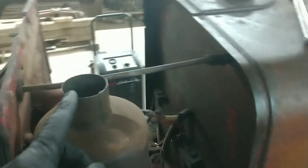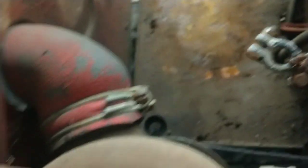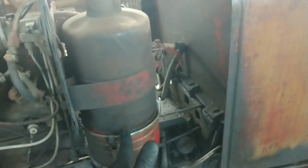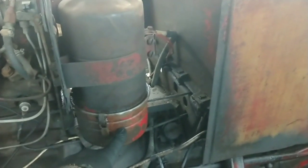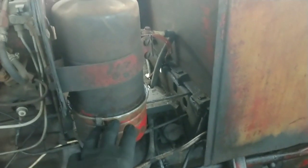So you see up here, air obviously comes in. It goes down a canister, and then the air comes out here, also at the top. Then there's a throttle body — this diesel actually has a throttle body, the intake manifold for the engine. The air comes down here and goes through an oil-soaked filter mesh screen. It's filled with oil to this line, and the air actually passes through the oil and bubbles up into the filter.